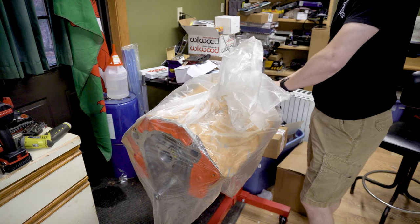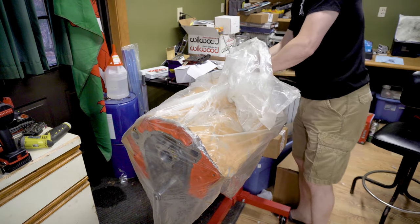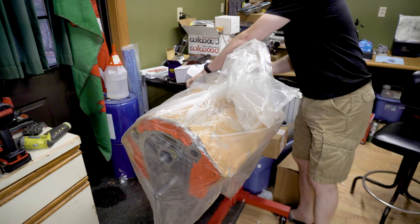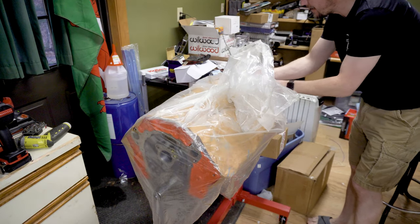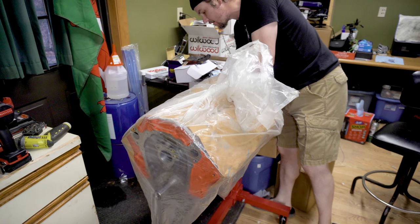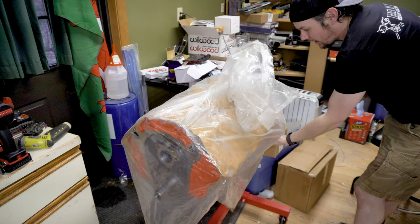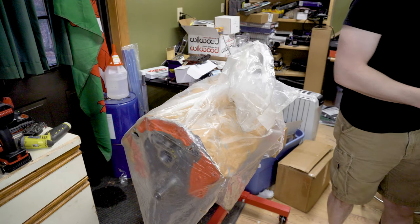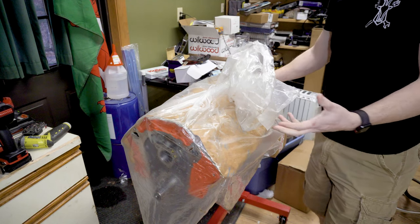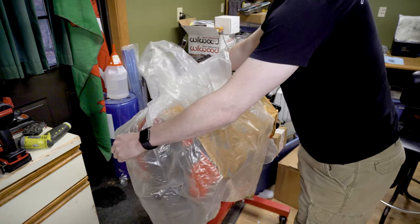If you go watch Engine Masters episode 36 — where they use the same exact block — they do a couple of things a little bit different. They're running a more aggressive cam and heads that flow a little bit more. They're running Brodix heads also. I'm going to be running a Brodix BB2 Extra — a 365 head. The nice thing about mine versus theirs is it has a smaller combustion chamber, so we'll actually have a slightly higher compression ratio. They were running 10 to 1 on Engine Masters; we should be closer to 11 to 1, which makes it a good pump-gas 93-octane motor. We're only getting about 370 CFM airflow at 700 lift — we're going to about 690 on our cam — whereas they were running something like 780 lift. I didn't want something beating the valvetrain quite that hard, but if we decide we want more lift down the road, we just upgrade the springs, swap the cam out.